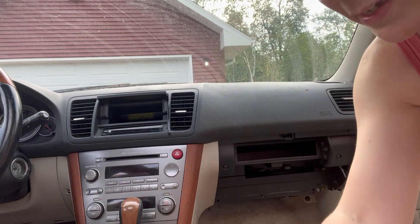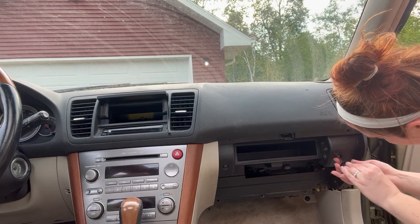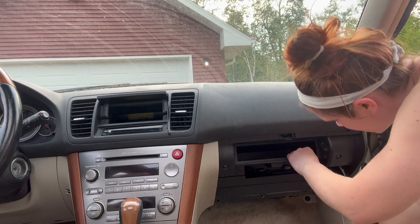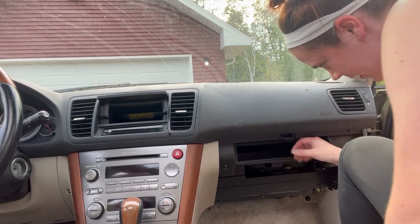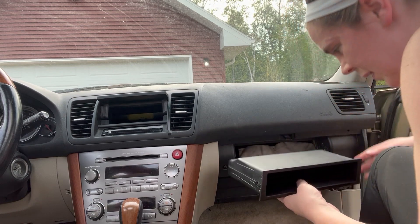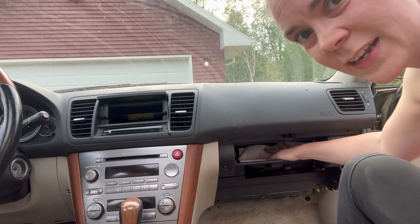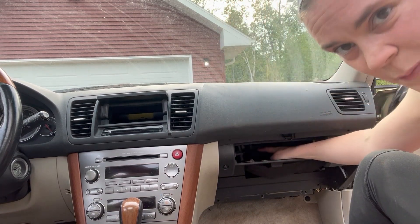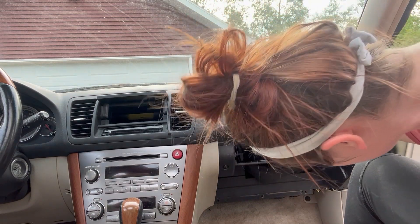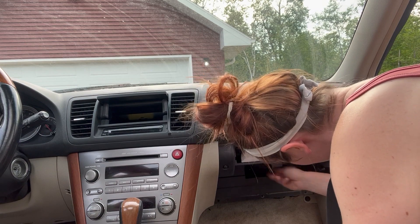Again, don't lose these. I'm going to actually take this out first. Here are a couple of clips — there's an 'up' marked so you know which way it goes back in. In here is your cabin air filter. There are two pegs on top and two pegs on the bottom. These you just push down and pull out a little bit.